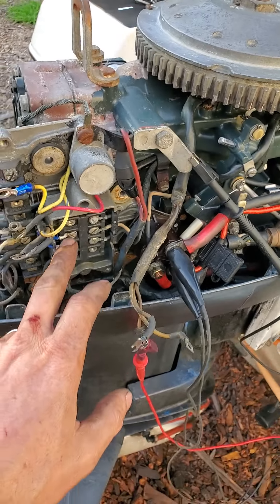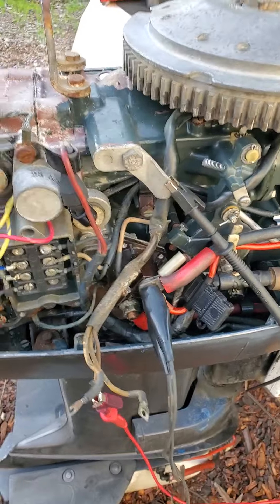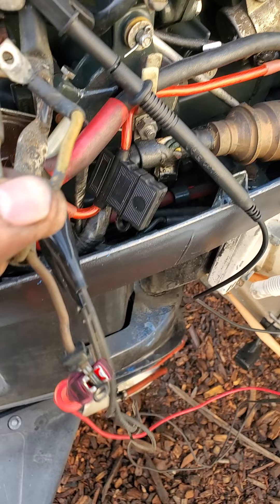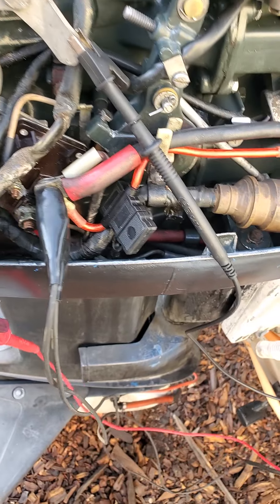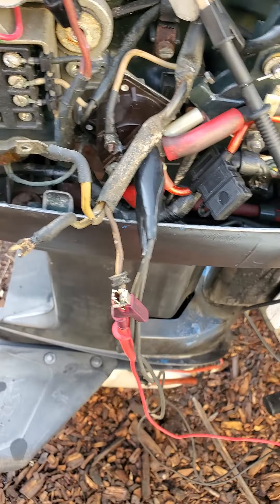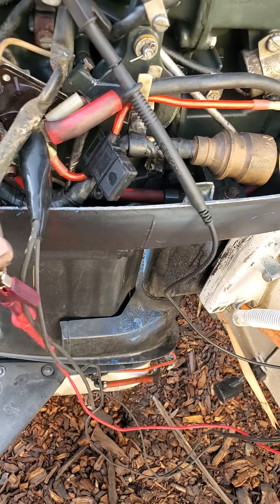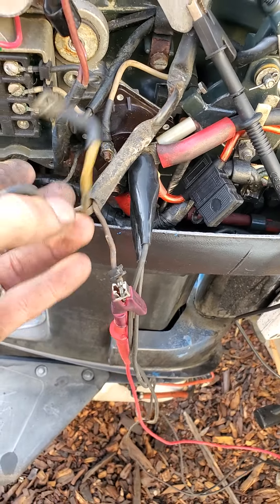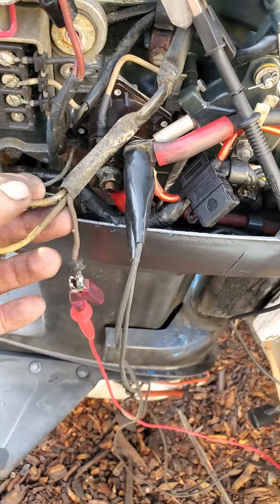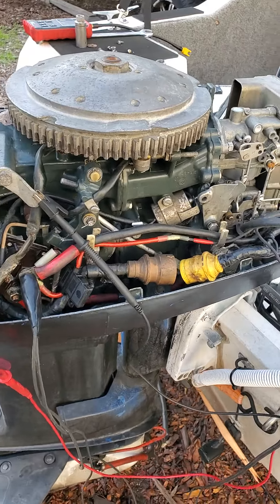Now you might have different color wires, you might have aftermarket, but the principle is the same. I also need to add that all stators are going to come with wires that are just purely for charging your battery. So in this case it was these two — they were once yellow, they are now something else. Sometimes there's three. Just ignore those completely — they don't matter, they're there for the battery. You test these when your system isn't charging. But for a no-spark troubleshooting, you're only concerned with the wire or wires that are not all the same. Usually these will all be yellow, or they'll be yellow and white, or they'll be green or something — they're completely separate. Follow the manual, and you guys would definitely be able to figure it out. Thanks for watching!